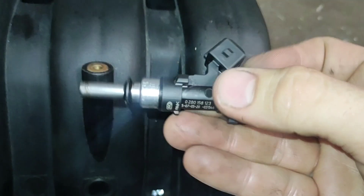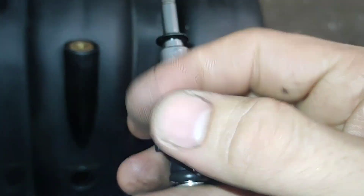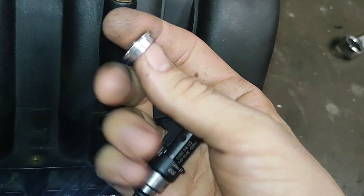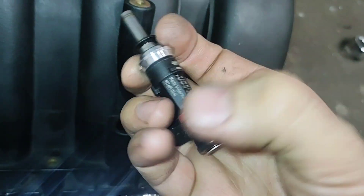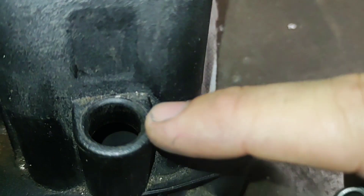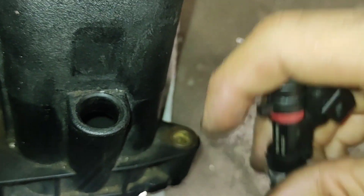With this style of injector, this plastic O-ring retainer is built in, and if it breaks, there's not really a way to retain the O-ring anymore. The solution to this problem is this little injector spacer that Seams Legit Garage sells. You have to pull the O-ring off the injector, put the little spacer on — that stops the injector from going in too far. Your O-ring will sit where it should inside this recess instead of pushing all the way down into your runner.